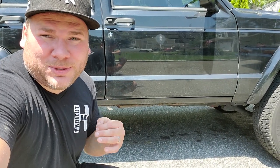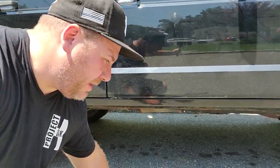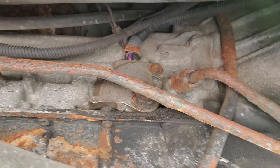If you're having trouble starting your XJ when it's in park and sometimes you've got to bring it into neutral to get it started, or maybe your reverse lights won't work, there's a good chance your neutral safety switch is on the fritz. To get to that thing you'd have to crawl up under your passenger side — this is your neutral safety switch up under there, next to the exhaust.